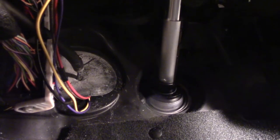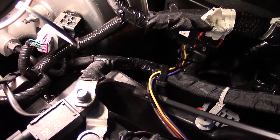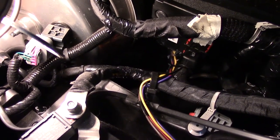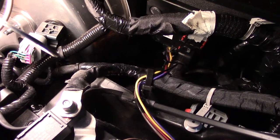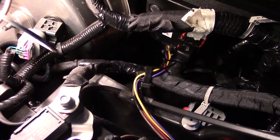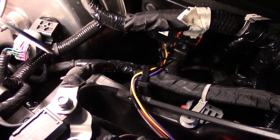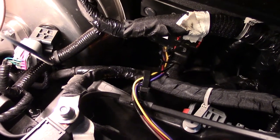Let me show you on the engine side what it looks like. Now it's a bit harder to see on the firewall side, but I'll do my best to show you because you're looking towards the bottom of the firewall, and the battery and other cables are in the way. But right where the laser is showing right here, that is where the parking brake cable is coming out, and that's where I ran my wires — the yellow and the brown wire — and they're coming through the firewall.